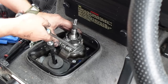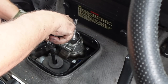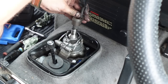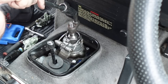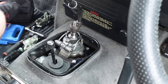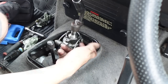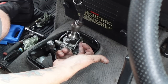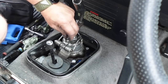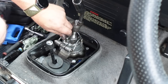Leaved with it past the bolt and over the bolt and onto the pin. Same again this side. Now if we refit the gear stick and test — they say put it into third. So we've got fourth, there's third — and I've got movement. What I've got is a rocking movement between the pin and the spring, so what I need to do is lower that spring so it's touching the pin and stops that wobble.